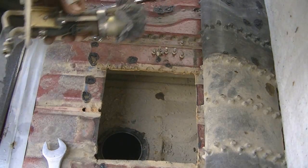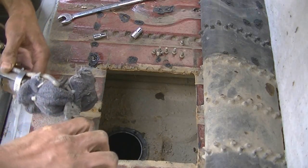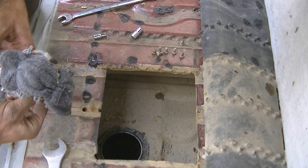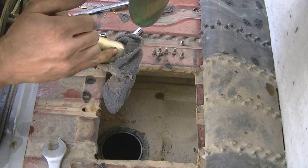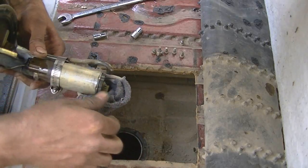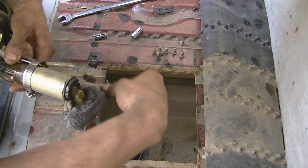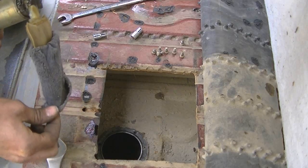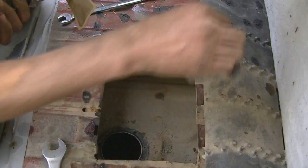I guess that drained out all over the freaking 4Runner. Okay. Zap straps hold up quite well in gas. A little bit discolored, but they still work pretty good. This sock is soaked. Oh yeah, look at all the freaking... Is that dirt? That looks like sand. That might have been when I pulled the fuel pump when we were at McLean. Yeah, there's sand all over the inside of the sock. Dang it. Oh, I'm not going to knock that into the fuel tank, so... Metal still managed to get past the frickin' sock. Dang it.